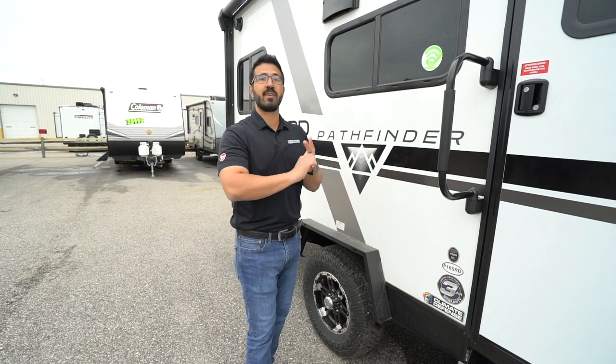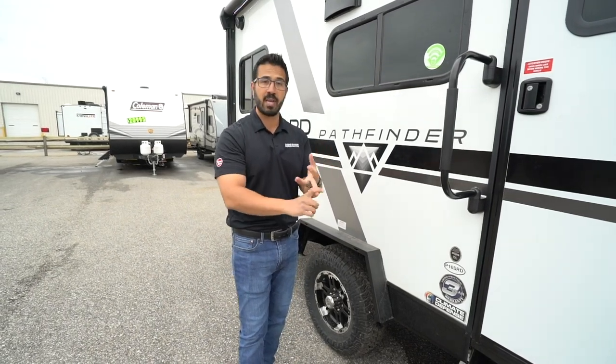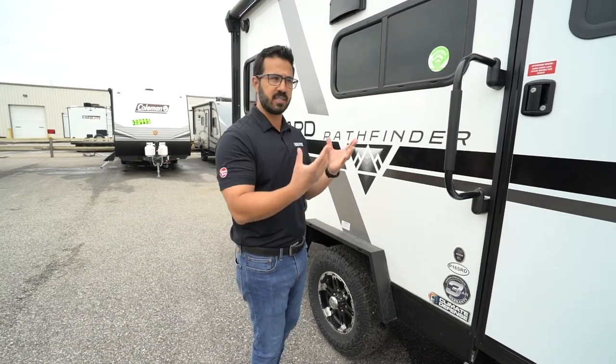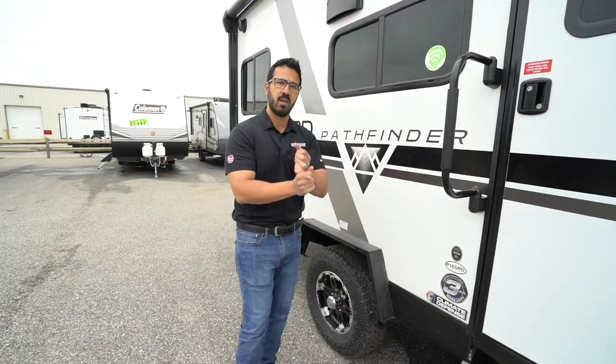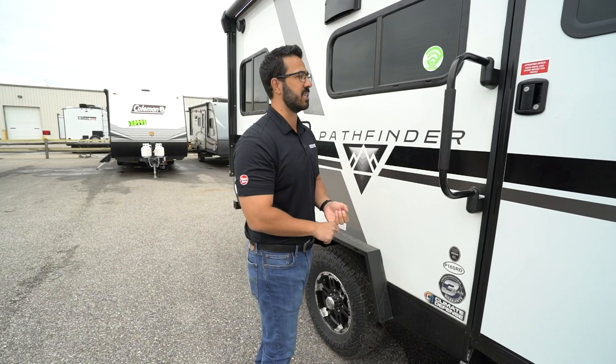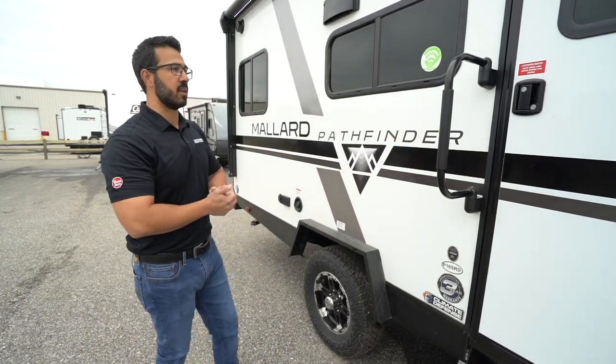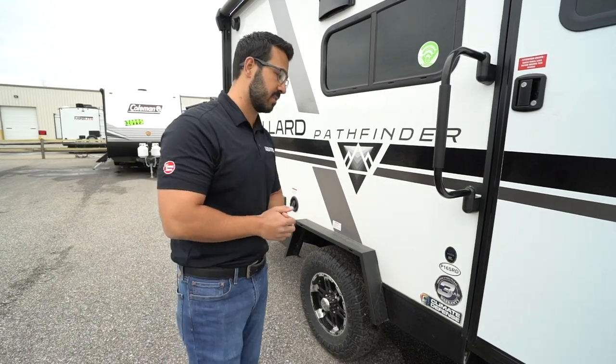Now, it is more expensive, of course, because it has nothing but benefits otherwise, right? It's lighter weight. It doesn't have any off-gassing like sometimes you will get with luan, so if you're sensitive to smells, it won't affect you, and it will almost completely prevent delamination, which is those bubbles you sometimes see in the sidewalls of laminated units. So big benefits to the Azdel there.